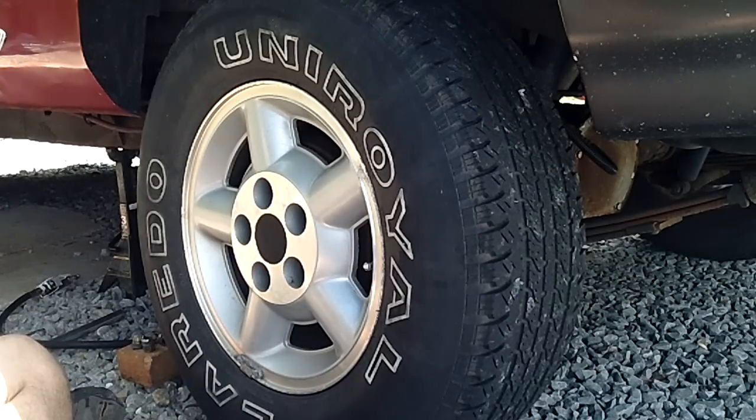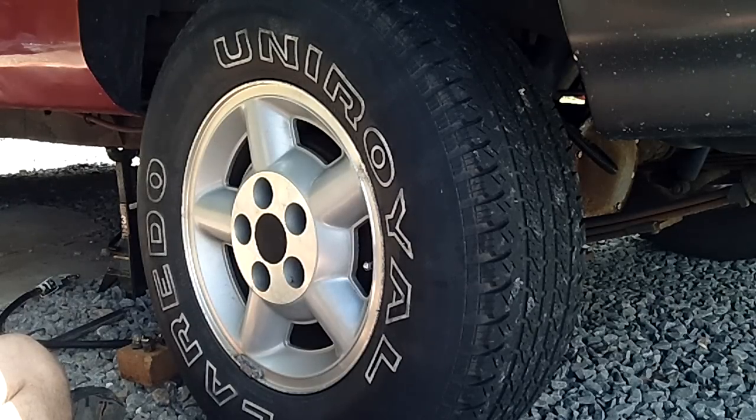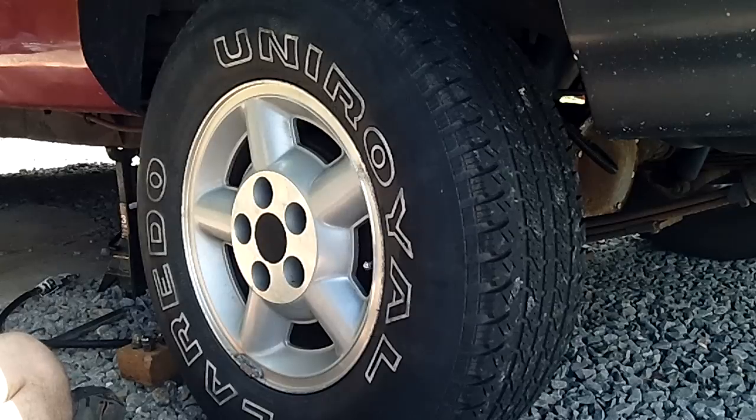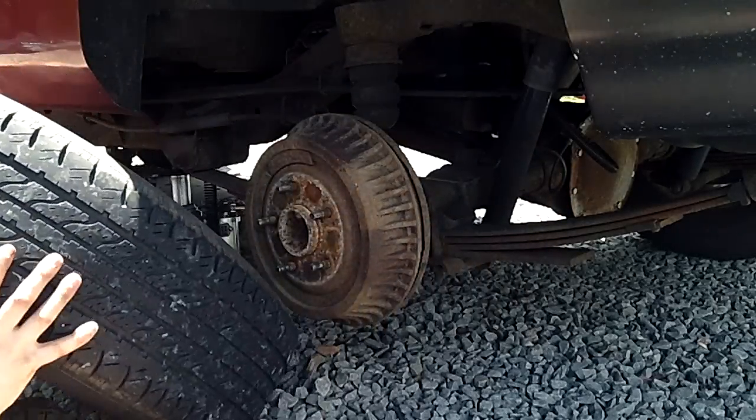It's the horizontal style, so it has a long tank that stretches out with wheels and a support on the front — a five and a half non-oiled air compressor from 1998. I've used the heck out of it. I've painted entire cars with it, used air sanders — anything that requires compressed air. Don't go any lower than 30 gallons if you can. If you're only doing basic stuff like removing lug nuts, a 25–26 gallon will do fine, but don't go lower than that or you'll regret the purchase.